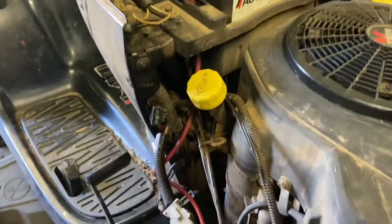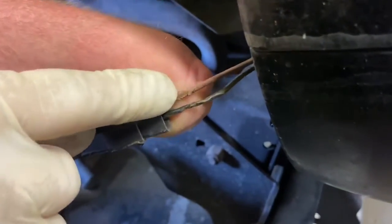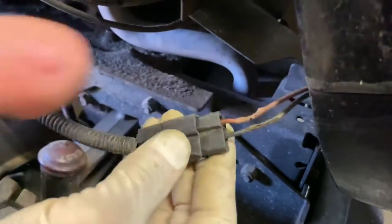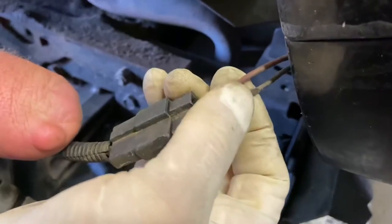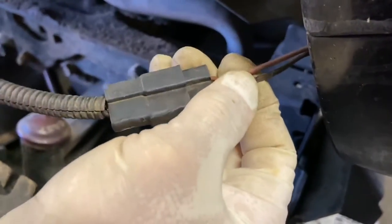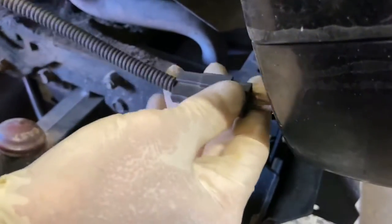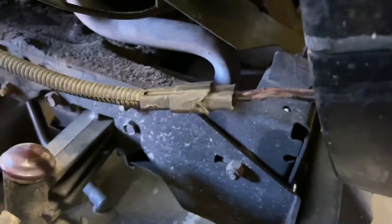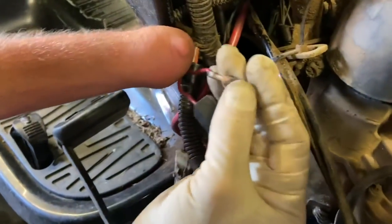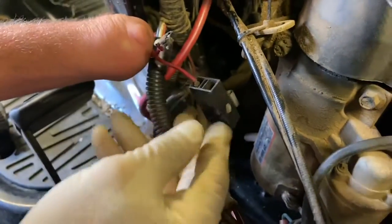A lot of times what I've found is that right here we have a bad wire and another bad wire on the light circuit — for his headlamps. What happened is they were touching each other, and I'm pretty sure that's the cause. So I'm going to snip these off and put some solder butt connectors on. Also, look for bad wiring on your headlamps — I think it's from people shutting the hood on the wires or them getting pinched. I've seen this a few times. The fuse holder over here actually just popped out from the bottom and was starting to melt, so I'm going to put a new fuse holder on as well.